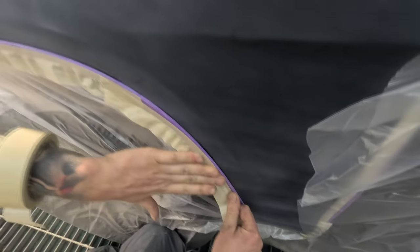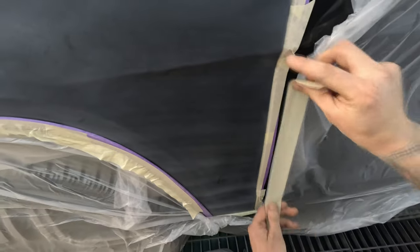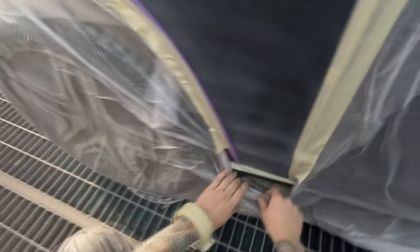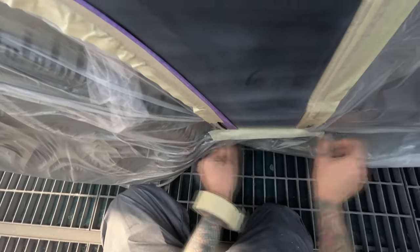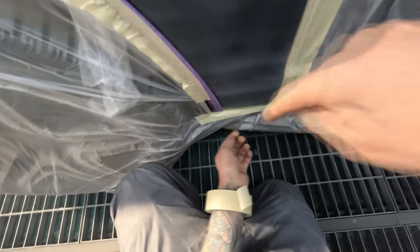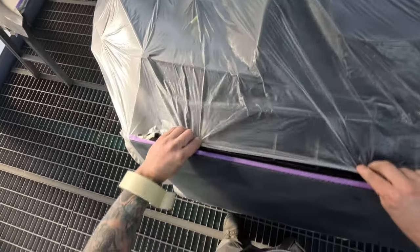And that's probably why I didn't have this issue when I was in Perth, because I don't remember seeing this when I worked there, because it's a lot hotter and drier over there. I actually did use the slow blender all year round already. Because it's a bit more humid and colder here in Melbourne, it's probably why I decided to use the normal blender, so it dries a bit quicker once you get it down. But yeah, it all seems to make sense, and I've tested this on the bumper on this car. So this is gonna be the big test, you know what I mean? But I think we're gonna have it nailed. It's good to overcome a problem.